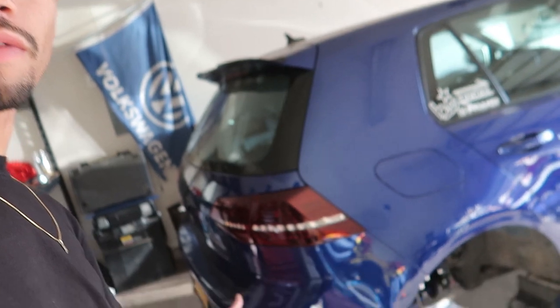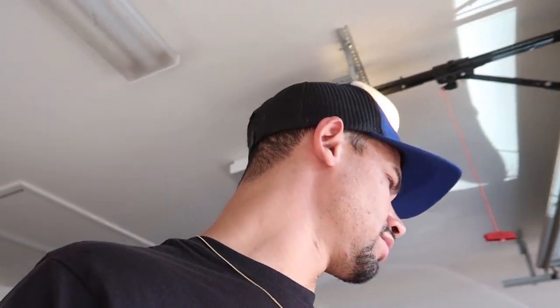As the title says, we're about to rip off this bumper and take away the crash bar. My guess is it weighs somewhere between 10 and 15 pounds — easy mod to get rid of weight and it's free. The crash bar is really only there for low-speed impacts like 5-10 mph. I don't know how much this car will even be street driven, but we're trying to shave weight and turn this thing into a race car.